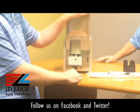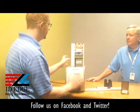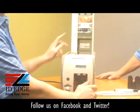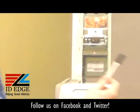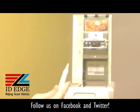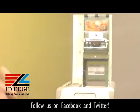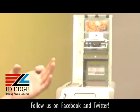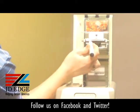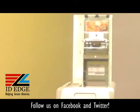Now we'll clean the printhead. The printhead is this little bar right here that's exposed — it's kind of a gunmetal gray. You're going to take this pen, pull the cap off — it is alcohol-saturated as well. You're just going to run this pen right across the printhead, just back and forth a couple of times, and you're done.